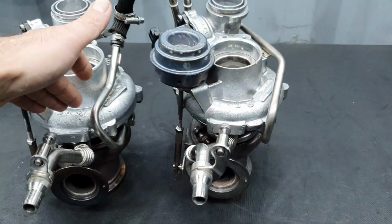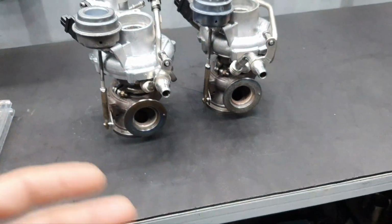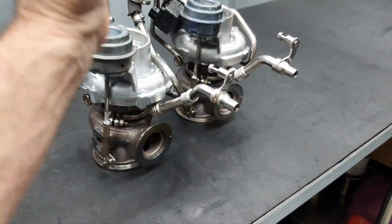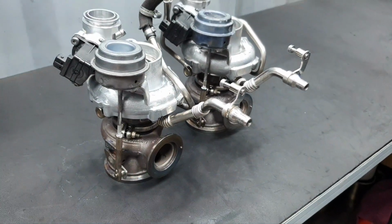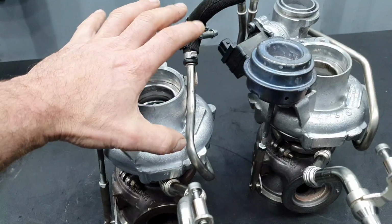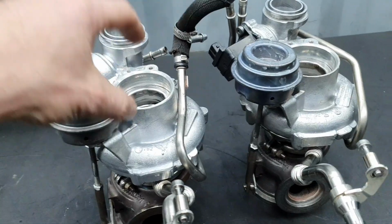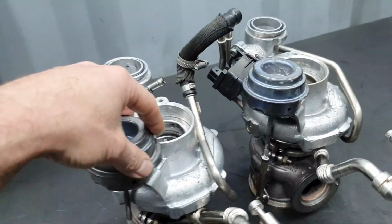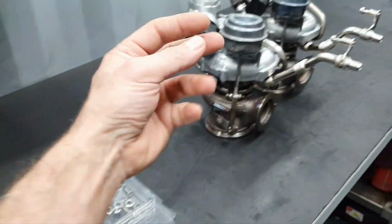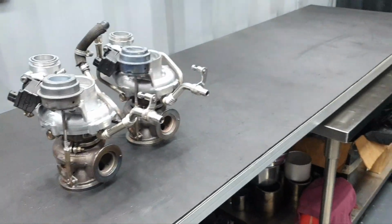Both turbos, the cartridges, have 300,000 kilometers. Now that we changed these parts, we bring it back, let us say, not brand new, but to around 40,000 kilometers. I guess the wear that the cartridge has has run out a little bit. All right. If from the point of balancing it's fine and doesn't make any sound or any vibrations, I believe that on the specific owner, on the specific car, it will last another 300,000 kilometers. That's what I believe. Until the O-rings start failing, it's going to start having carbon and this kind of stuff. So, we're going to see in the future.